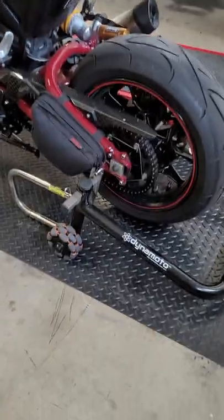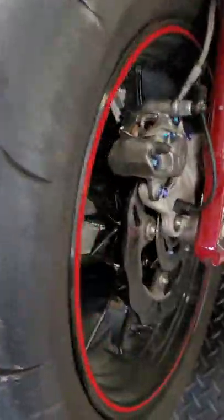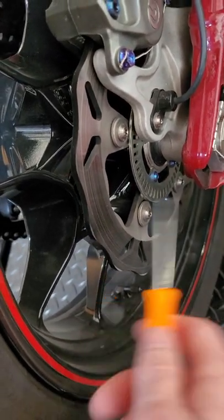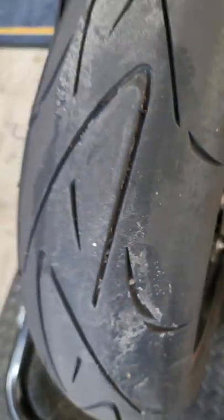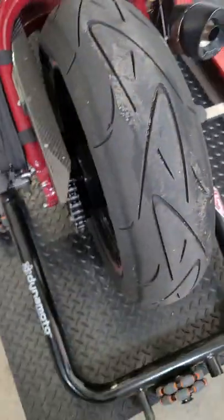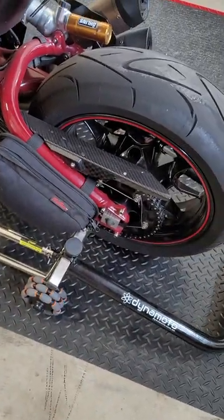The rear is the simplest. All you have to do is remove the drive sprocket on the left side, then the tone ring and the brake rotor on the rear. Bolt them onto the new wheel, add a tire, and it goes right up. There are absolutely no clearance issues whatsoever. You do not have to machine or make any offsetting rear bushings. It is a straightforward bolt-up process.